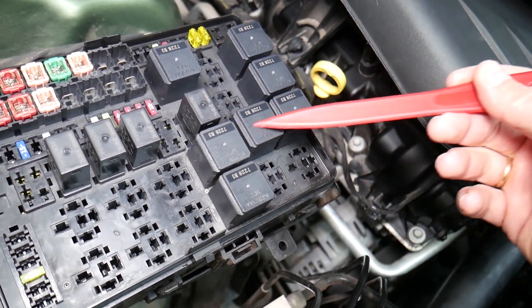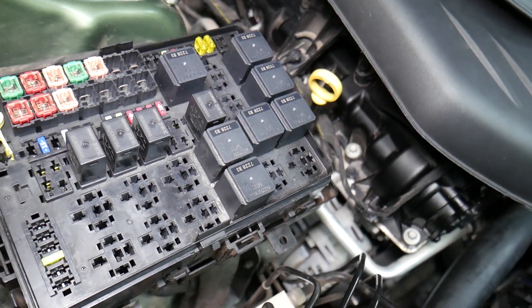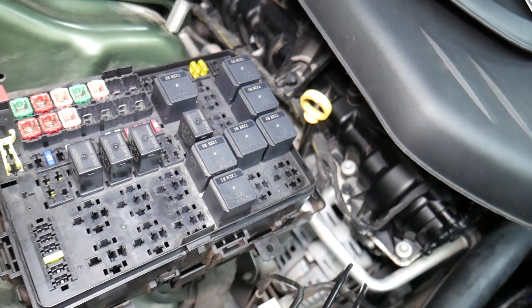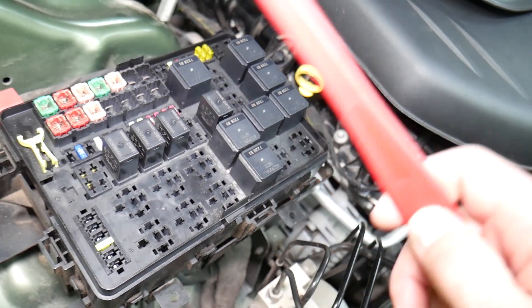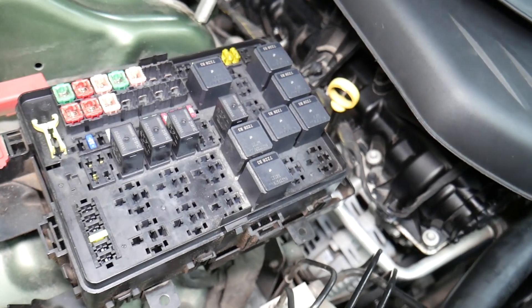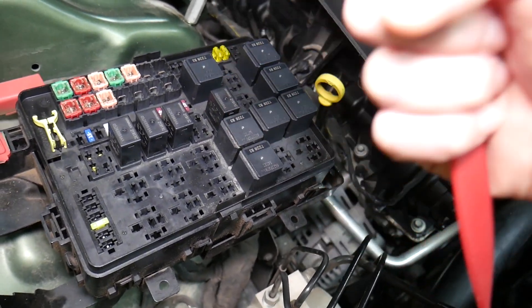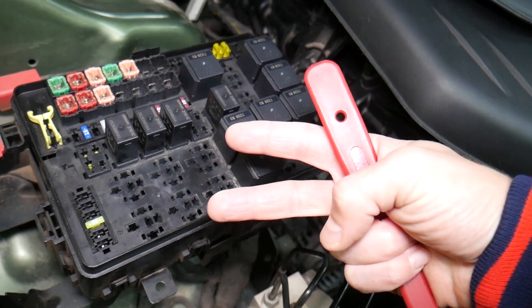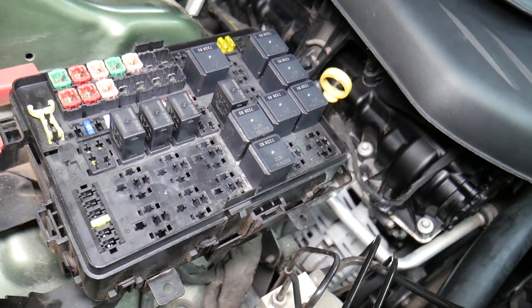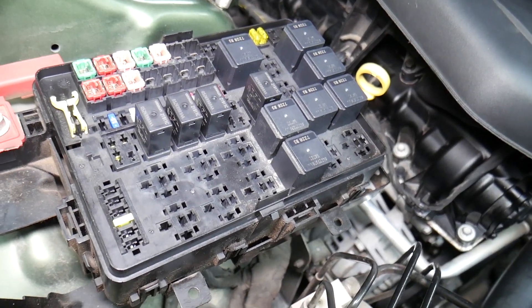The same thing for relays — some of those could be really expensive on cars. We'll put a link in the description below on how you can test relays. For some certain fuses, it's important to disconnect the car battery when removing them, otherwise you can burn the electronics. For instance, when working on airbag fuses, you need to wait at least one hour after disconnecting the car battery, and if you're not qualified and certified to work on an airbag system, I would never recommend doing that. When disconnecting the car battery, a common mistake people make: it's important to know which battery terminal you disconnect and reconnect first. If you do it the wrong way, you can burn electronics modules — we actually burned the traction control module on a BMW before, which cost $2,000. We'll put a link in the description below on which battery terminal to disconnect first.